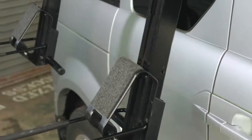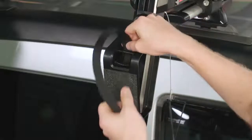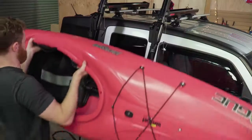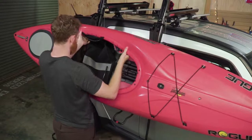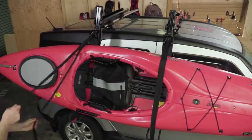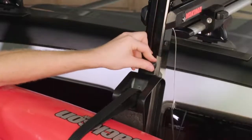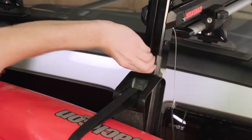If it's too close, you'll need to re-adjust. Time for straps. Insert the strap ends down through the inboard cradles. Adjust them so the buckles are positioned correctly. Load your boat — gently rest it on the support hoops, then make sure it's balanced. Bring the straps around to rest on the boat. Loosen the knobs and slide the saddles to meet the boat, then re-tighten the knobs.